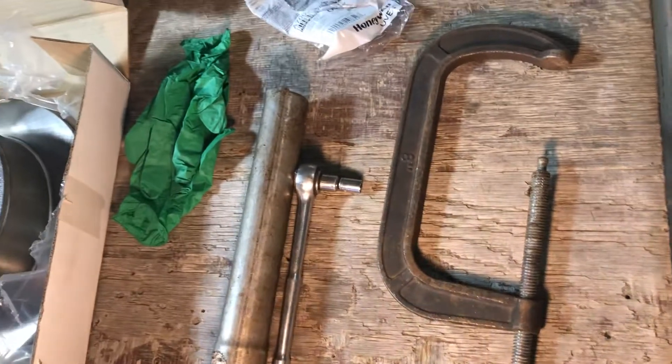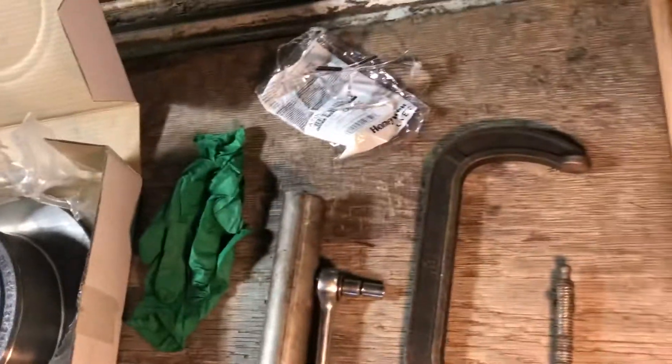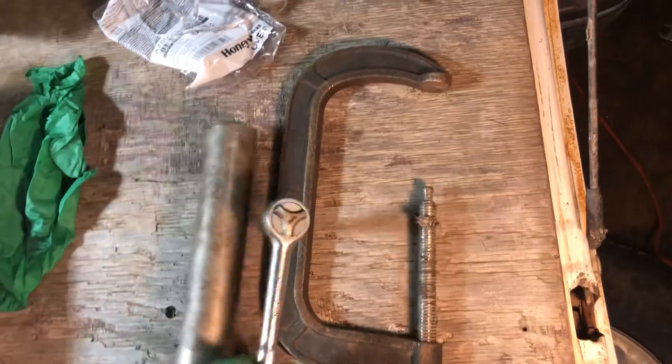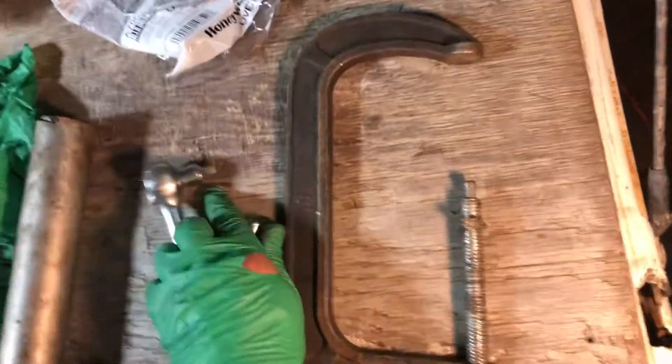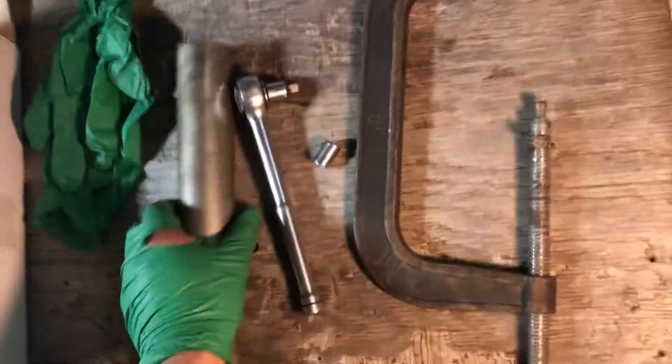So what we're going to do here, we're going to replace brake pads and rotors. And you see here — I'm going to tell you guys what tools you're going to need. You're going to need this tool to push the caliper back, and you're going to need a number 10 socket. And a little pipe to make it easier for yourself if it's too tight.